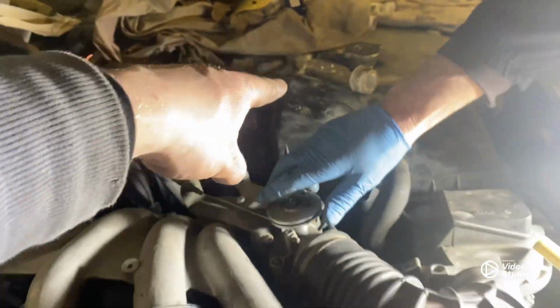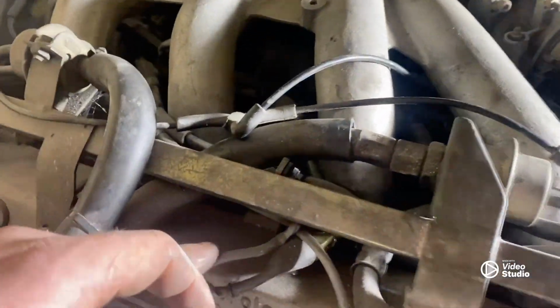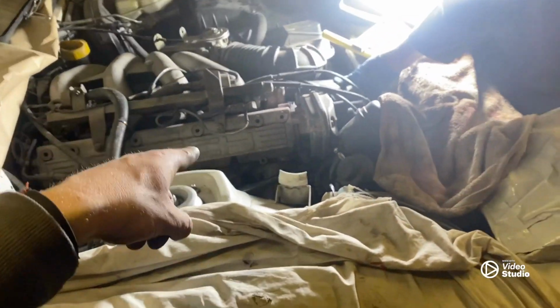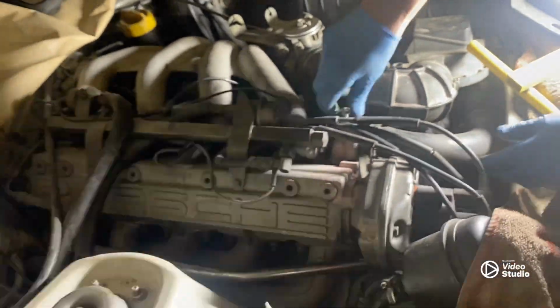We'll then put the head gasket tester in there. You can hear a slight chuffing, one of the seals has gone on one of the injector rail things there. You can see the slight wetness, so we're going to need a new set of O-rings for it. We're just slowly letting air bleed through there. We need a new bleed screw for that as well.